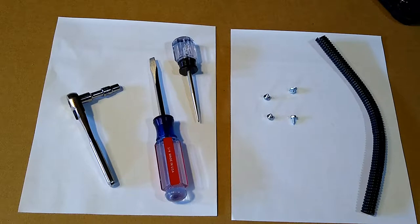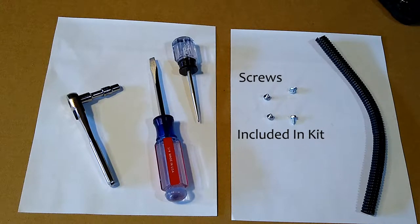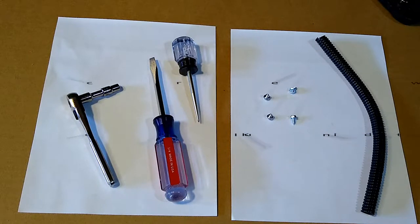In the installation instructions for the brake controller, it says to use a 1/8-inch drill bit and drill to drill the pilot holes to mount the mounting bracket. I chose not to do that. I just used the scratch awl to poke some very small holes through the soft plastic in the location I'd chosen, and then I used a wire to probe the holes to make sure there was nothing behind there that the screws may impinge upon when I was mounting the bracket.